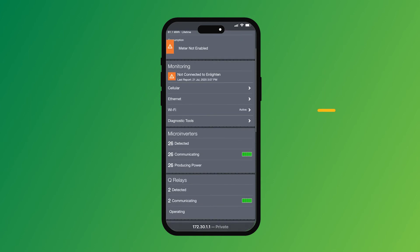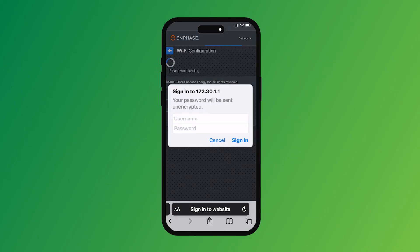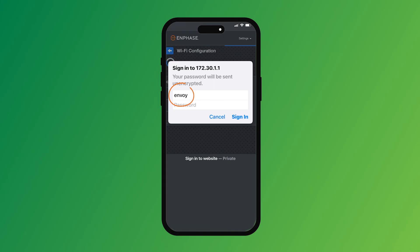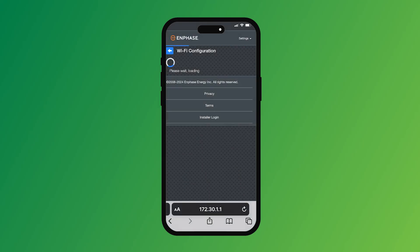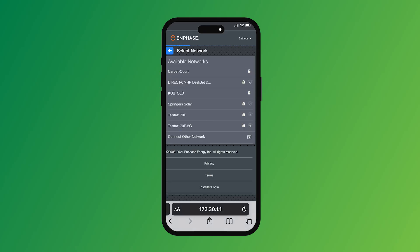Come down to your Wi-Fi settings here and click on Wi-Fi. You've got a new network — whatever it might be — you can forget the old network that's in there and then connect up to the new network. Now it's asking us for a password. The username is Envoy — that's the name of the device we're connecting to. Then put that number in that was at the back of the Wi-Fi connection, sign in, and we're away. This might take a few moments to load the Wi-Fi configuration. Once we're in, hit 'View Network' to connect up to our new network.